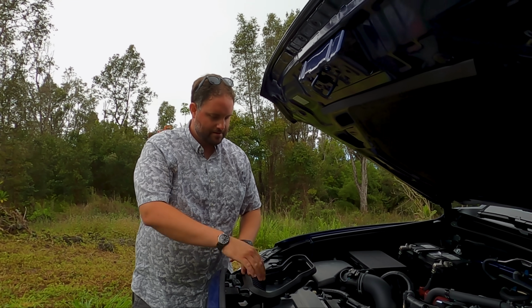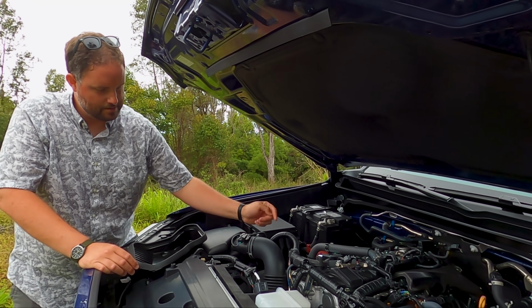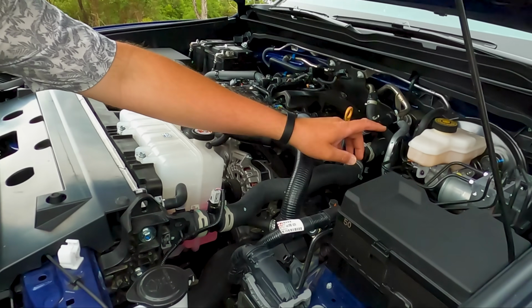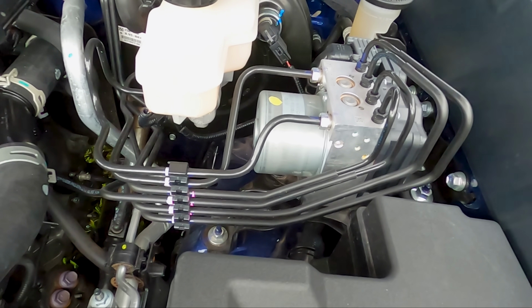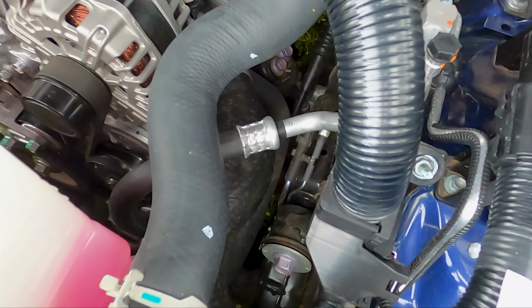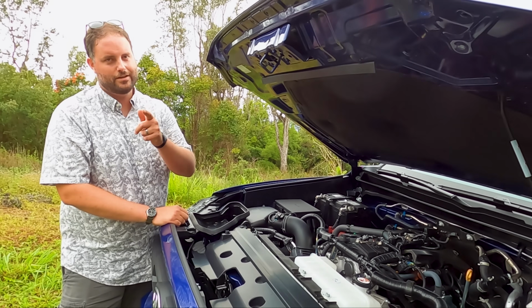And just like the other Tacomas, you've got your air intake right here, and it actually ducts down and goes into this air box, shoots right into the intercooler. You do have a drive-by-wire throttle body like everything does now. And as you can see, you keep the ECU and your multi-port ABS for your electronic brake force distribution. You can see down there, there's actually a fully boxed frame. All the trucks have that all the way down, because you have a lot of rigidity and stiffness. But we've got something special to talk about that is powertrain related on the interior. Let's hop in there.